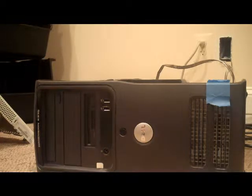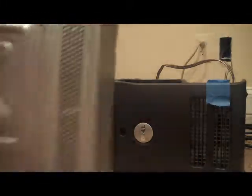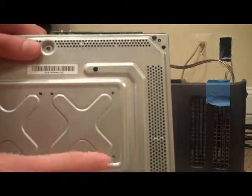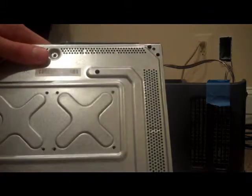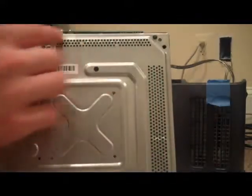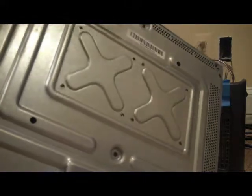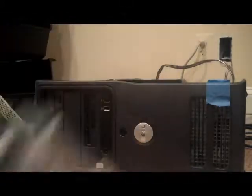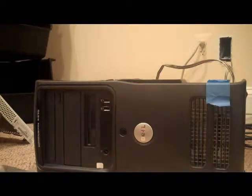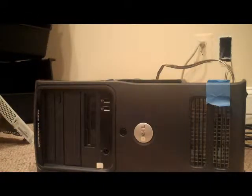What you're gonna need to do is flip over your Xbox and you're gonna see right around here — you need to put in screws here, here, here, and several more positions — nine screws total. There are little black screws in the middle like the ones on the RF board, and the other ones are smaller silver screws, not the big ones you take out to open the whole console.